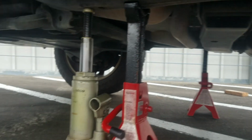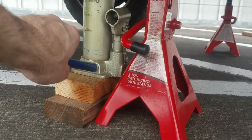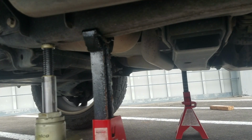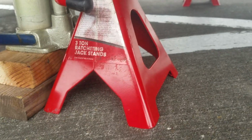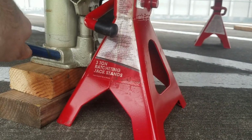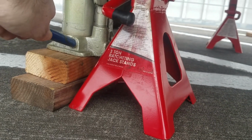First off, put the Sport in extended suspension and then put the parking brake on. Then jack up the entire front end. This is important to even out the torque on the sway bar so it's free to move around. I tend to leave the jack in place as an extra support.